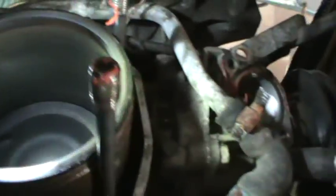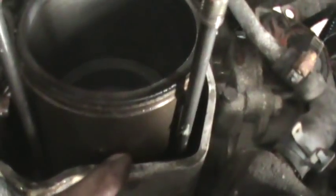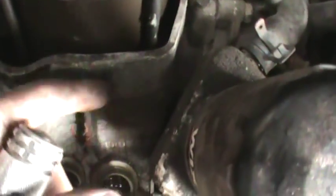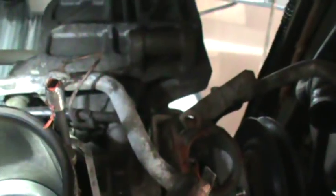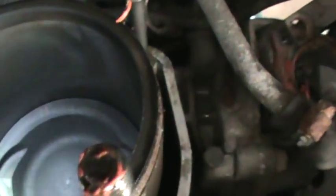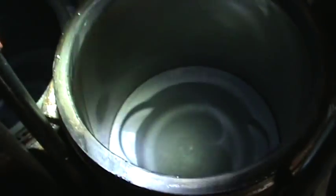So basically what we're looking for as far as a failure on this is blow-by — we're looking for where compression was getting out of the compression chamber and pushing into the cooling system. If you look, you can see these are the cooling jackets, pretty much the only area on this block that is coolant and doesn't flow through the heads. What happens is it just has to get over this ridge, and once it's up over this ridge it's into the coolant. This is the cylinder I was suspecting, and you can see a dark spot right there — I have a feeling that's where it was failing. The rest of it looks like it sealed pretty good. That one looks a little dark on the bottom too, but I see shiny all the way around on that one, where the other one I don't.